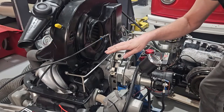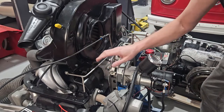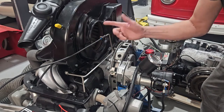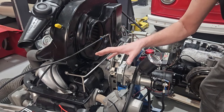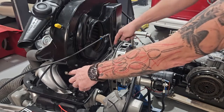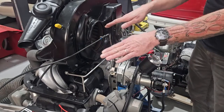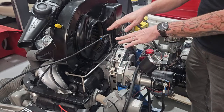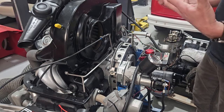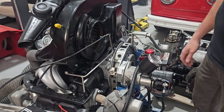Right here is the heart of the system. We call it the spray bar system — it's just made of a bar. We've got a stainless steel rod built into a framework that attaches with one bolt on the side of the shroud. You attach a misting nozzle — it's a patio mister — and that's going to spray dead center into the fan. We've made this so that while the engine's in the car you go to install it, one bolt right there, you locate it into the case. You can install this without really seeing what you're doing because we've made it fit and go exactly where it needs to go. Installation is easy. It's stainless steel, so it's not getting rusty because we are introducing water to a system. Long-term, you want things to last and work.